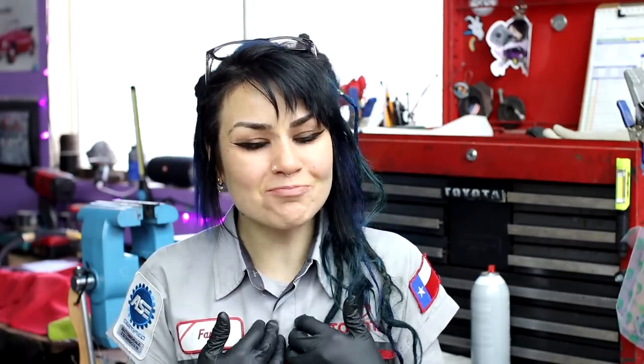Why would I pay $1,500 for a steering rack when it's literally not causing me any problems? It's not causing the owner any problems. Why would I spend that money when chances are, I'm going to put one in there and a few years down the road, I'm just going to see that same sort of seepage out from the boots again. So anyway, what am I going to do about this? Well, I'm going to continue to keep the long life coolant in the Tacoma and flush every 30,000 miles. I'm going to continue to monitor the seep at the timing chain cover, and continue to monitor the seep at the power steering rack boots, and probably continue to do nothing about any of those things.